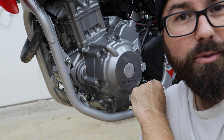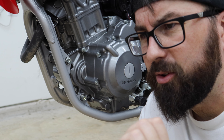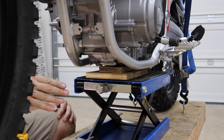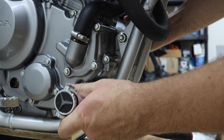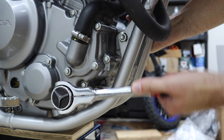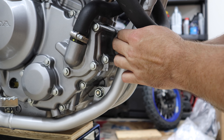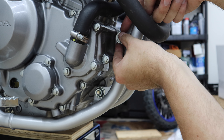These are two motor mount bolts — there's another one in the rear and one up above. I'm slightly not sure if I can pull both out without having the engine drop, so I'll just touch it up on the bolt without removing fully. These are 14 millimeters. I'll crack them loose and try to hold the other side still. Both seem loose — we could just pull these out. There's a bolt, a washer, and it looks like there are some aluminum spacers in here too, so I'll have to be mindful of all that.